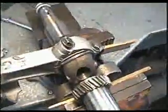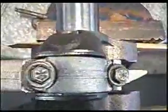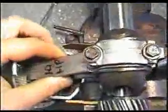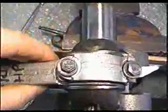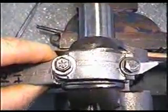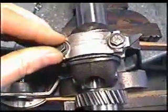Here's what the problem was. The connecting rod is loose on the crankshaft — it's even loose if you move it sideways. If you grab it with your hands and move it back and forth, you can see the slack right on the shaft itself. There was looseness all around.